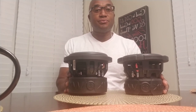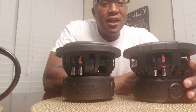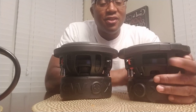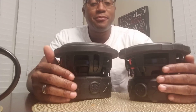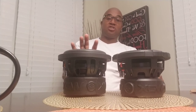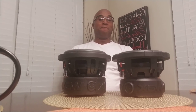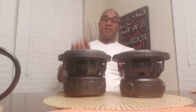Now let's look at the specs of these subwoofers — you'll see a vast difference. If you look closely, you will see that the spider pack on the G2 is thicker than the spider pack on the G1. They're closer together on the G1, farther apart on the G2. The surround is taller on the G1 than it is on the G2, but yet this one has 15 millimeters one-way X-Max, while the G1 has only 10.